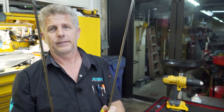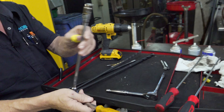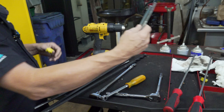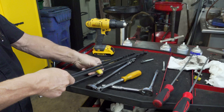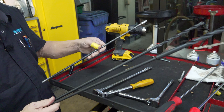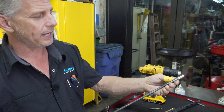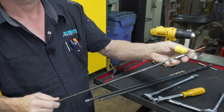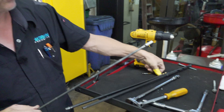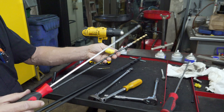Some of the tools I use: a number two Phillips and a big screwdriver so you can reach in and manipulate things. A T12 Torx on a swivel. Some longer bolts that I stick in on the end of the shaft to hang the column so I don't have to move it too much. A couple of different drill bits — I usually don't use these but just in case, because you never know. I've had this little contraption made from a drill bit with a small end on it to keep everything slim. This will be the drill bit for the final hole, and I'll be sticking the other in one of my screwdrivers to manipulate the little wheel inside.